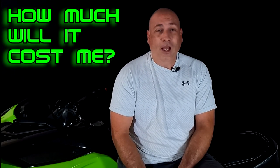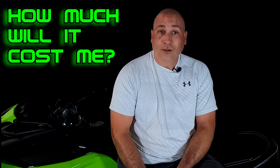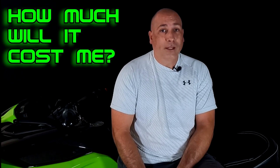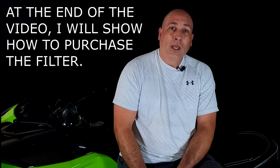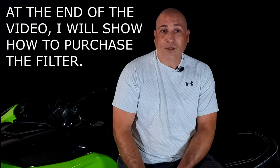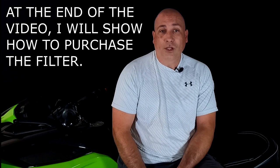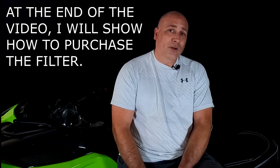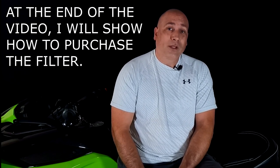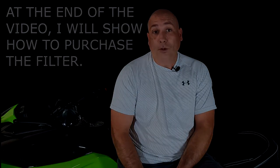The big question everybody really cares about is how much is it going to cost. The initial cost is more than that of a standard filter, but not a whole lot more, and the K&N filter will probably last you at least 10 years or the lifetime of your bike if you treat it well. It is currently December 2020, and on Amazon I can purchase one for roughly $45 to $50. At an auto parts store and on Amazon, I can purchase a recharge kit for roughly $10 to $15. I try and clean mine at least every six months, and over the lifetime the K&N filter does save you a lot more money than purchasing a disposable filter over and over.